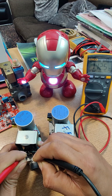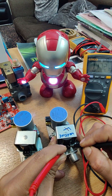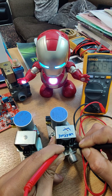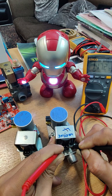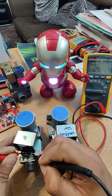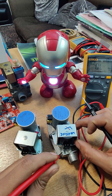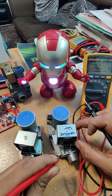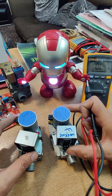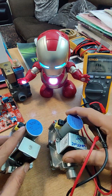The reading on the cooler valve that's been outside in my van is around 112.5 ohms, and the one that's been inside reads around 117 ohms. The expectation is 140 ohms, but personally I consider these to be okay — it's not dramatically out. At 117 and 112 ohms, the reading is not too far away. It's not open line and it's not as if it's only 10 or 20 ohms or 500 ohms. So we consider both of these tests passed.